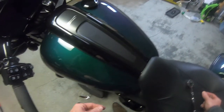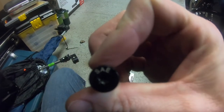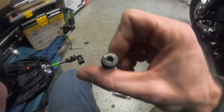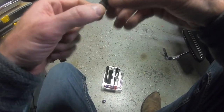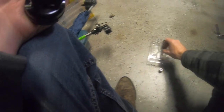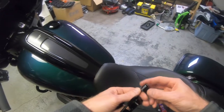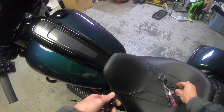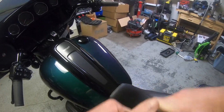After further looking at these screws, the lower set says SAE where the others say metric. Being a Harley I'm assuming SAE, but vehicles nowadays — even made in America — still have metric parts. Blue Loctite is going to be your best friend on a Harley because of the amount of vibrating it does. Blue Loctite is removable with hand tools, so you don't need heat like you would with red Loctite, but it'll keep it from vibrating loose over time.